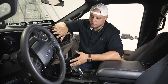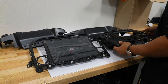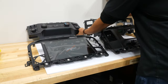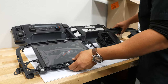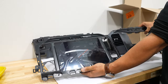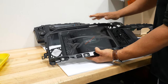On the bench you can see we have our 12-inch screen and our old bezel. A bunch of this stuff is going to get swapped over. The media controls down here will get swapped over to our new climate control piece. The old one doesn't have a spot for the volume and everything. Also with our new screen you'll notice we have a button up here that wasn't in our truck to begin with. Because it has three knockouts, you're going to get a third one covered just so you don't have an open hole — that's not going to give you a feature, it just covers the hole.